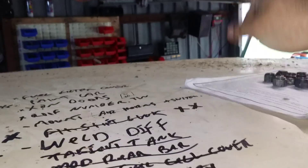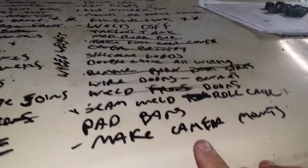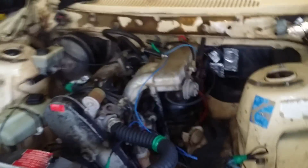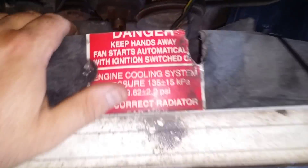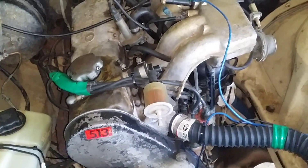I've even got a bit of tin to put the roof number on. It's up to you if you want to weld the diff — I was going to but I ran out of time. All the wheel weights have been removed, pad bars, camera mounts — which I obviously didn't get around to doing. I was going to seam weld it — I started on the other side on the front doors because I could do that in this class — but I'm just putting a patch on them. With the chain they're not going to go anywhere. The thermofan is zip-tied on and something in the last couple of hits will unzip it anyway, so it's irrelevant — it's just out of a VN Commodore. It's got a circuit breaker on there so it doesn't really matter, it'll just trip. All the vacuum lines have been disconnected from the brake booster, so you do have brakes, just have to push down on the pedal pretty hard. This is just a breather so it doesn't suck water into the motor when the radiator goes and mud and crap get in.